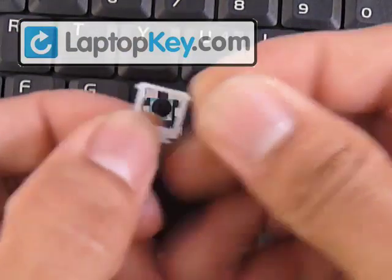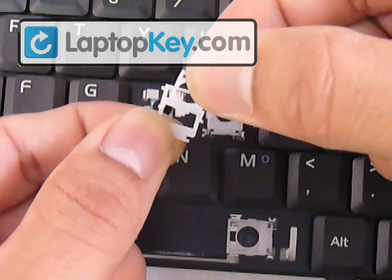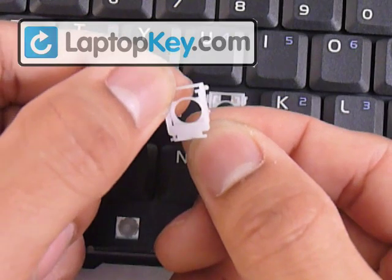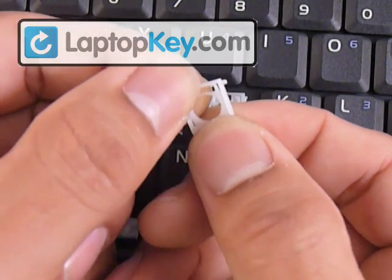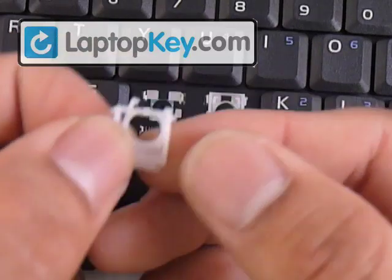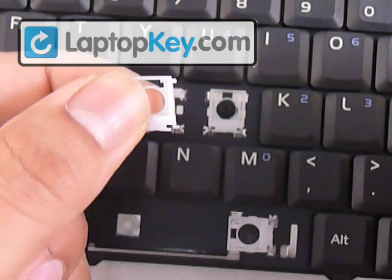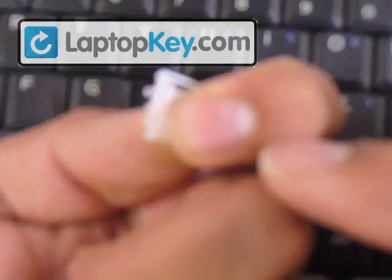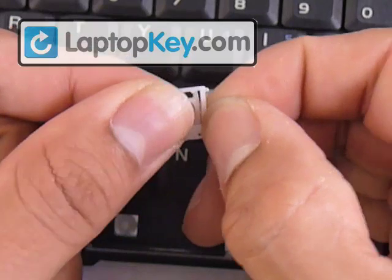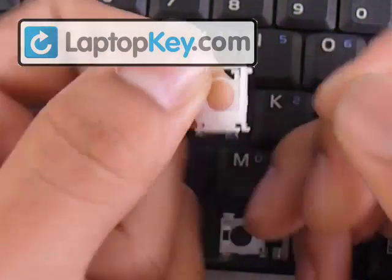What we have to do is put the small piece underneath the large piece like that. Then you want to slide it through and click those pins. Do the left pin first — click it into the hole in the large hinge. Once that's in, hold it so it doesn't come back out. You can see there's another pin that has to go into the other hole. Hold both pieces and separate the large one from the small one so that the pin has enough space to go into that hole. Now both pieces are one.